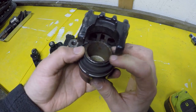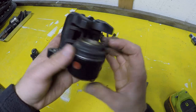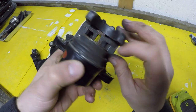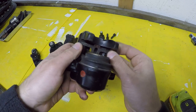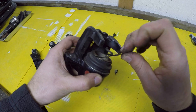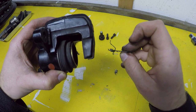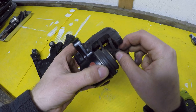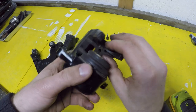The piston goes this way — I actually put the piston in wrong on mine, so I'm going to have to pull it out and reverse it. You can buy those pistons on Four Into One. The other weird thing was this clip; right now it's being held on by the piston so I'm not sure I can pull it out at this point. On mine it basically just fell out when I disassembled it. With this clip, if you're looking at it like this, that little piece on top will sit towards the top, so that goes up, and then it slides in like so. I think this is just to keep pressure on the pads to keep them from rattling too much while riding.